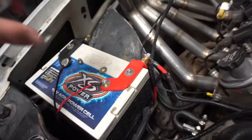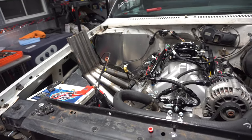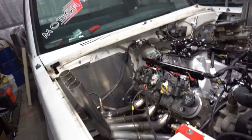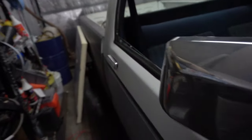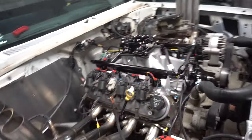The power wire is hooked up, going to hook up the ground here in a second. I need to get the little fire extinguisher ready just in case something catches fire. I'll probably hook up my water hose that's right outside the door as well. I'd rather be more prepared and not need it than have something happen and not be prepared, because a lot of people have little fires when they first power up a car. I'm going to do that prep real quick and then hit power and see if we've got power to the fuel pump.